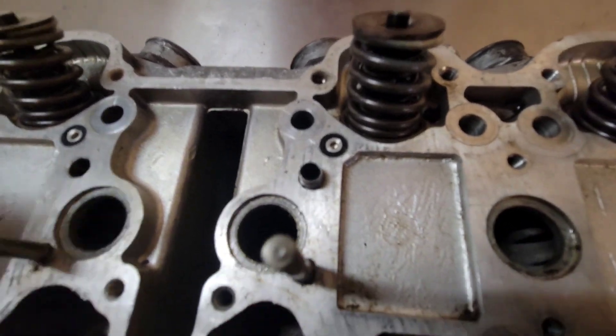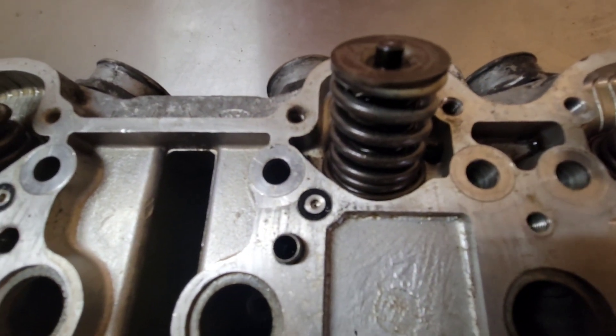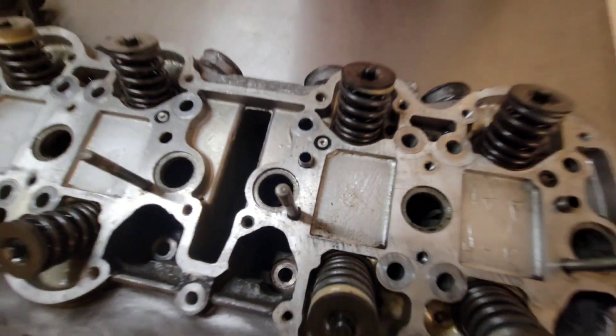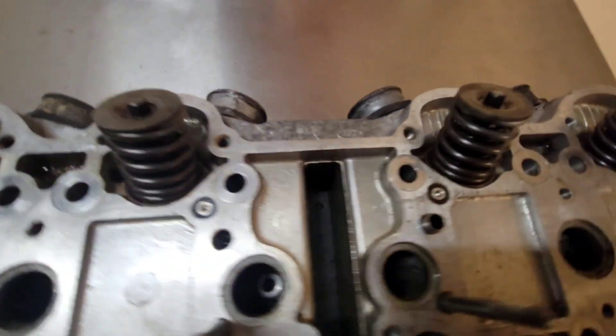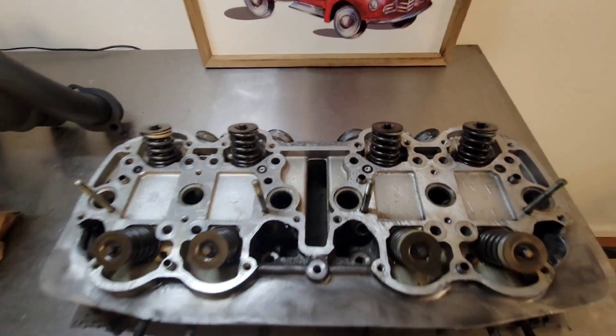What I wanted to show you here are these two — this one and this one. Those are the oil restrictors. Those need to be clean and clear — those need to be the cleanest part, essentially, of the whole engine. I've seen two now where those get clogged up, the cam and rockers don't get oil. One I saw, the camshaft broke in three pieces. I repaired it, put new stuff on top, put a new used camshaft in it with new rocker assemblies, it all fit perfect. Honda fitment is so good — you just have to make it that way. These two have to stay clear, really clean, and then everything up here gets oil and everything is good.